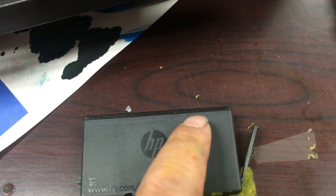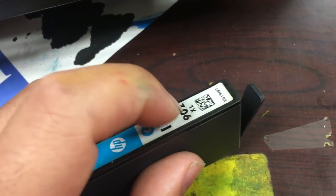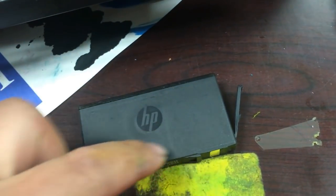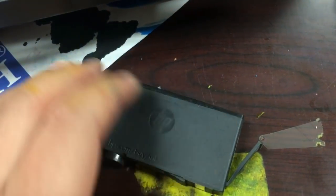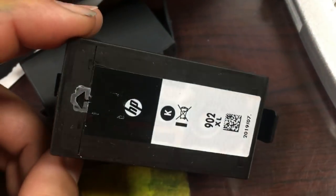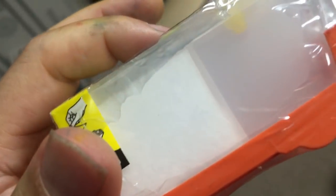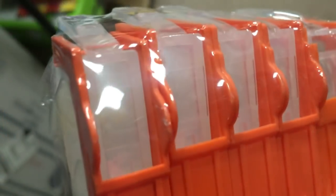In the next video, we'll add ink to the back chamber for the XL cartridge and double the capacity. The 902 XL Black is super wide and holds much more ink. Also, we're going to make some chip holders from the startup cartridges and let them use a chipless transparent cartridge body. Therefore, we can peek inside the printer and find out exactly how much ink is left in the cartridge.